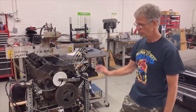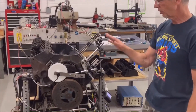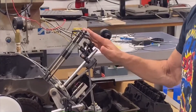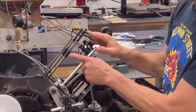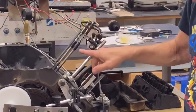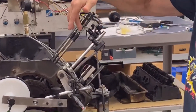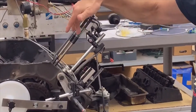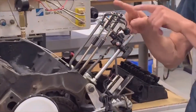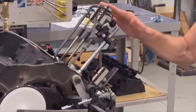On the stand you're going to crank off the damper and bar it over by hand. So there are going to be some differences here. We've got our lift sensors like you always have on our bracket with these accessories you can get from us. The lift sensor goes right on top of the push rod and it's fairly long to make sure everything stays nice and straight and aligns. We've got these helper springs here to make sure that the tappet always stays in contact with the cam. We always put this little strap over here because anything you can do to stiffen up this bracket on the lift sensors makes for much more accurate data, so we've got nice stiff attachments and the two lift sensors.